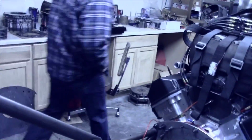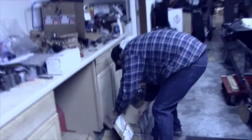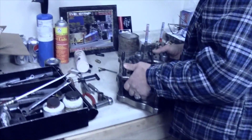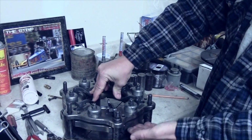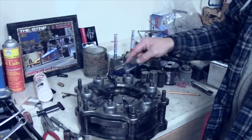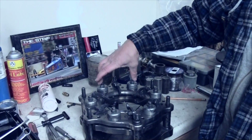I have a clutch here. Yeah, the clutch discs. You can look at this clutch. This is an older one. The clutches in these things are a centrifugal clutch. When you push the pedal in, it pulls this apart so your clutch pack's loose and everything spins. And when you let the clutch out, these cars leave on static. They have springs in them, so the spring pressure actually hits it. This is the pedal clutch. A centrifugal clutch would just have levers only and no springs.